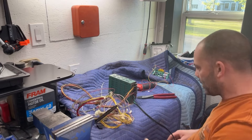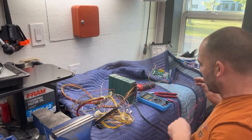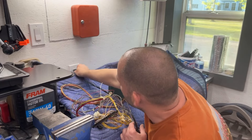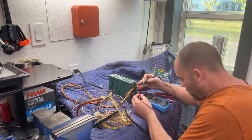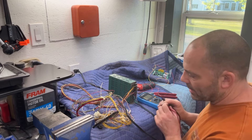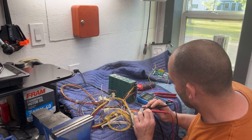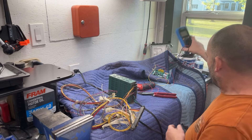I've got my multimeter here so we can check our voltages. You don't want to go plugging one of these things in if it's sending eight volts to your circuit board — that'll screw it up. Okay, there's no light on this power supply because it's old. Reading 5.16 volts — that's right at the mark. Let's check it at the harness too: 5.16. I'm going to leave it there; I don't think that's too high.